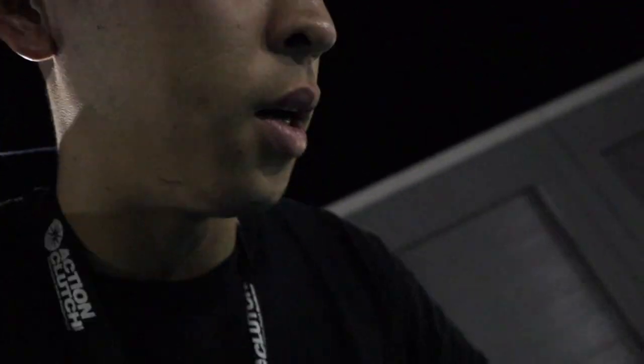So we're testing the car right now. I'm gonna leave it on for a couple minutes, see if it leaks. If it doesn't, then we're good. Oh no. I'm dripping so much oil, but I think I know where it's coming from. The little gold looking nut that holds the sandwich plate to the actual oil filter spot? I don't think I tightened that down. So we're gonna take out the oil filter right now and give it a little more.